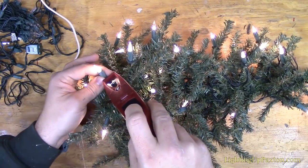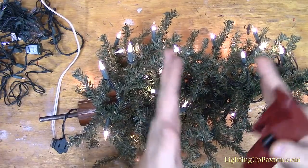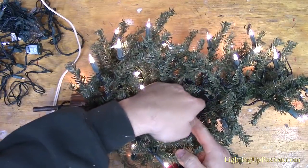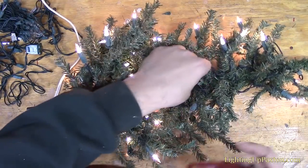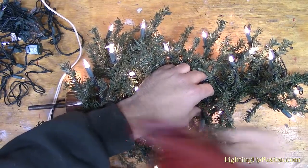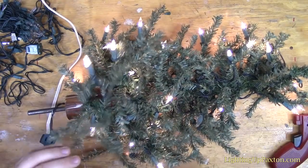I knew the bottom of the tree had voltage, but the top didn't. So our bad spot on the tree would be somewhere in here. So I just have to follow the wires around with some good lighting so I can see, and just keep testing bulbs until the tool quit beeping. As you can see in my other video too, you could always put clothespins around your tree to mark where you've already checked, so that helps you out.